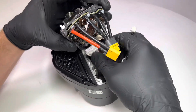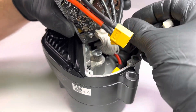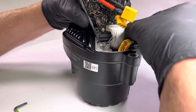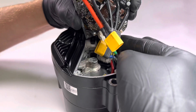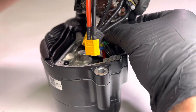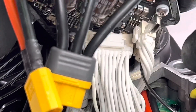There is a certain order you want to plug these in that we've found is the best way to install without damaging anything. First plug in the big com port — there's a clip on the top. After you get the main connector plugged in, do the temp sensor next — that's the blacked-out one on the bottom right. Then you want the torque sensor to go on the outside of the black temp sensor, otherwise that wire can get pinched when you try to fully install this. The third little connector is the torque sensor.